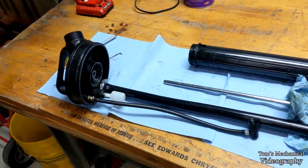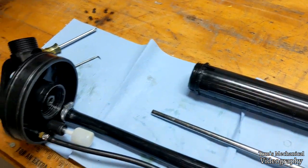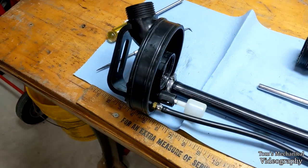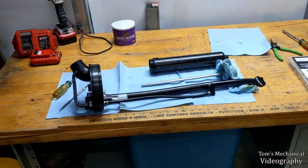Air flows from inside this, up through this float valve, into here, through that little port down in there, fills up this cylinder, and then you slide the piston forward and that pushes all that air out past the check valve and out to atmosphere. That's how you're pulling vacuum. Because that o-ring has failed up in here, every time I push this piston down it just sucks air from atmosphere through here and pushes it back out that way. That's what's screwing me up.